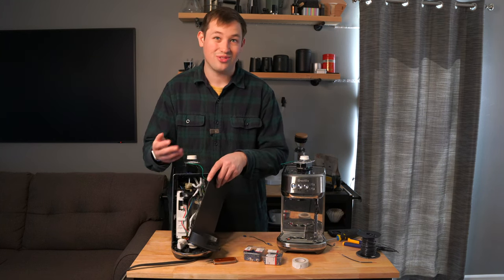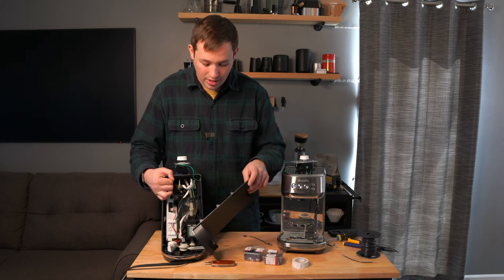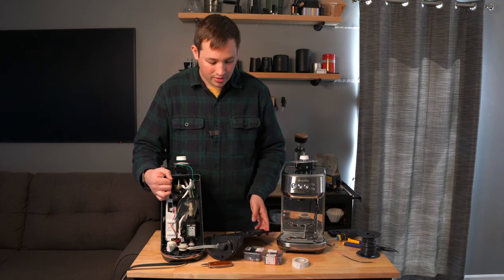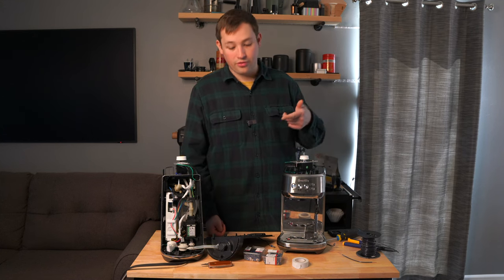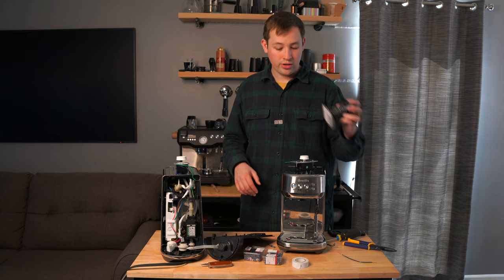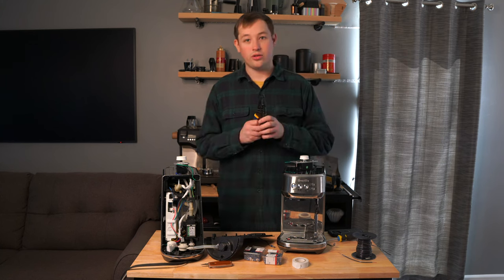You'll need more force than it looks — it was kind of half off when I got there, so I cheated a bit. There's a little tube coming down the back, so you just remove this back plastic part. You're going to need a screwdriver with a Phillips head, some male and female spades, electrical tape, 14 AWG wire, and wire cutting, stripping, and crimping tools.